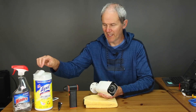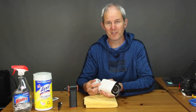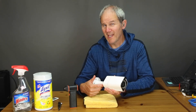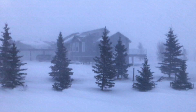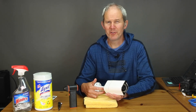Starting off, we're going to get the camera cleaned up as much as possible since it was outdoors for so long. The main camera seal looks to be in pretty good shape, but there are also other seals — the card slot seal on the back and where the wires enter the camera — we need to check all of those. One of these seals may have let in some humidity. This camera has seen temperatures as low as minus 40 degrees Fahrenheit and Celsius in the winter, which is well below the manufacturer's specified operating temperature of minus 10 degrees Celsius (14°F). That extreme cold may have caused the rubber to contract, allowing moisture to enter. It also gets soaked regularly during big rainstorms.